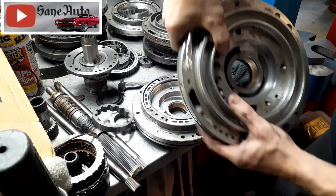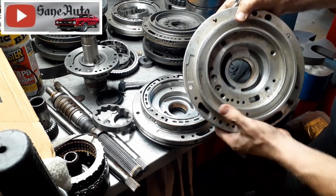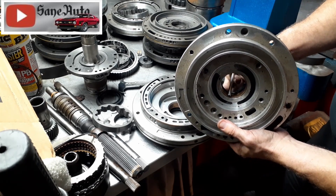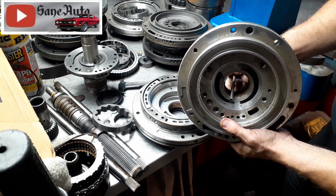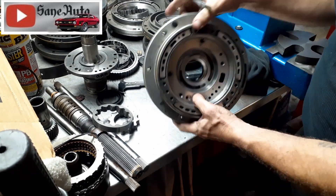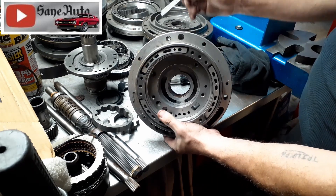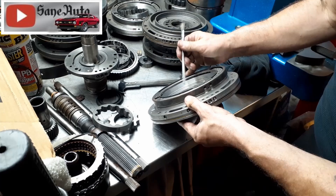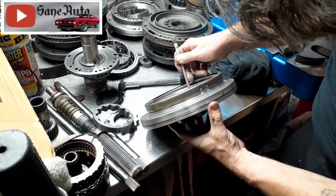Again, that oil groove is down here at the bottom, the top bolt hole is up here, and the oil inlet groove opening is right there where fluid from inside the pump can get in. With this next one, the bushing is in there correctly, but we have some damage on the outer edge here, and it looks great along the rest of the way in here.